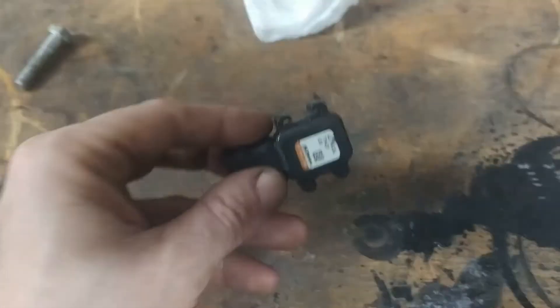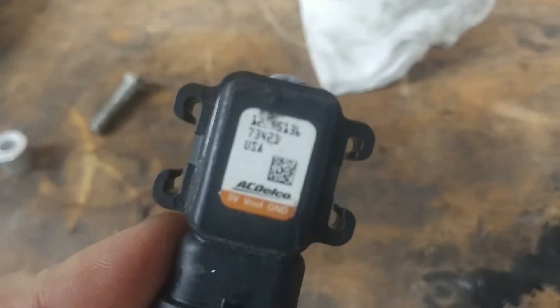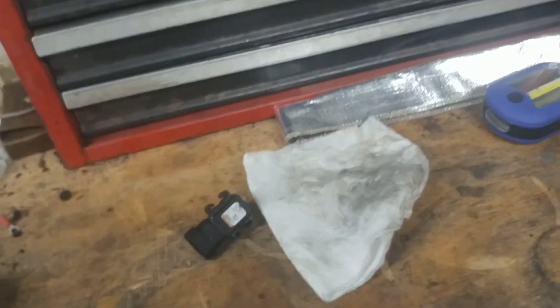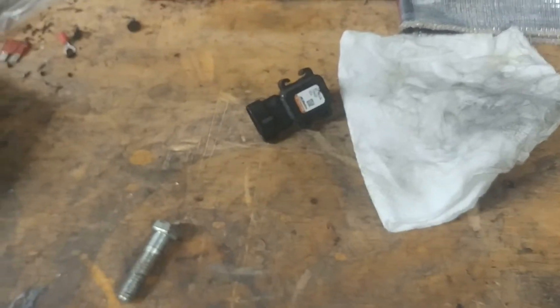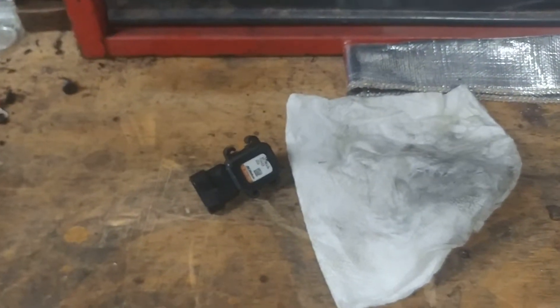What's up YouTube, how you guys doing tonight? I'm here about to put the up-arrow mod on the Camaro with Miss September. If you've watched any of my other videos, you've seen that I've been running a two-bar MAP sensor for about the last two years or so. One of the problems at the racetrack the other day was I hit my boost cut, which is set to 14 pounds by about a thousand feet.